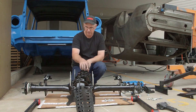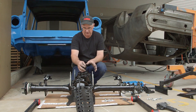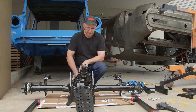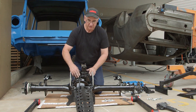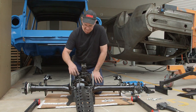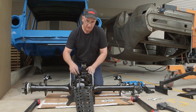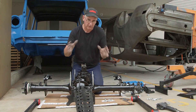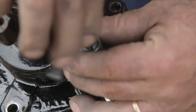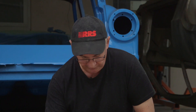The first thing in preparing to put a three-link into any of the RS applications is axle housing prep. If you're using a secondhand center, you need to make sure the surface where the torque arm bolts up is a machined surface — some have rough cast, which is not good enough. You have to put the pinion housing into a lathe and machine it flat and parallel, otherwise the torque arm won't line up properly. Then run a tap into all the threads to make sure there's full thread engagement for all the securing bolts.